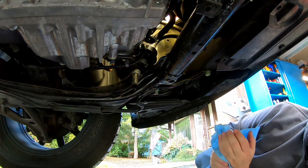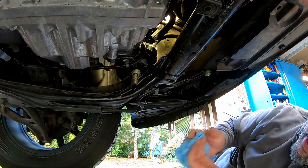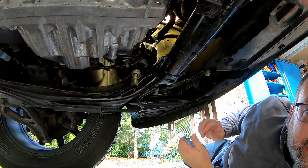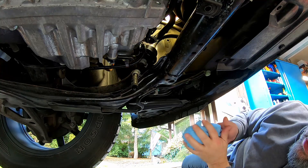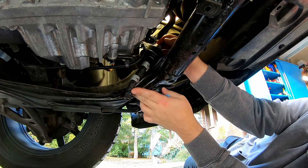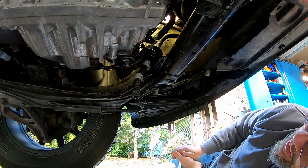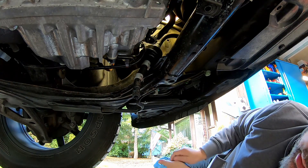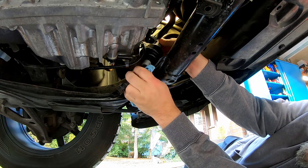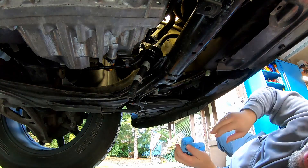Changing this filter — I haven't found anything online about changing this filter at all. The fluid loss from changing this filter, I don't think it's going to be a real significant difference to the quantity listed in the manual, which is 3.3 quarts of DW-1. I may just add a tenth more to cover the filter change, but I don't know if that's really necessary or not.